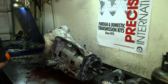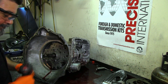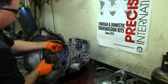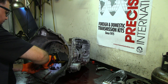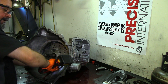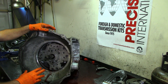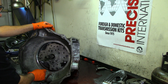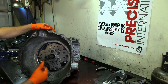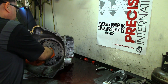There's the big hub cap — looks like the old hot rod hubcaps from back in the day, like from that Cobra movie with Sylvester Stallone. You can see the difference from the 45RFE and 545: the 545 has that type of front cover. The 45RFEs have a seal and a snap ring. The 68RFE has only the big seal on the outside and just one snap ring.